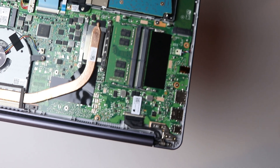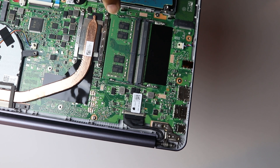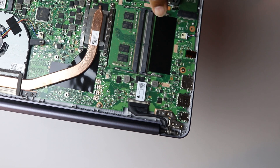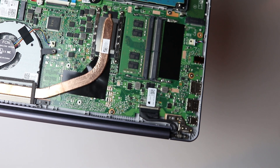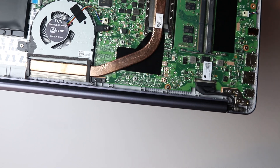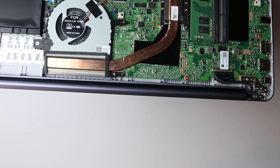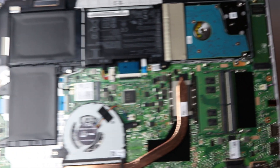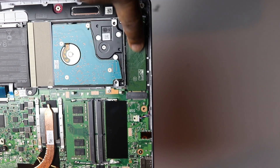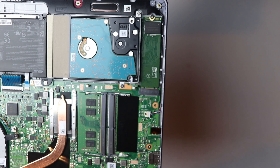The other cool thing is up here — this is my 8 gigabytes of DDR4 2400 RAM. There's another open slot for me to install another 8 or 16 gigs of DDR4 RAM. If you want to make your computer a little more snappy between programs, put some more RAM in. I'll put a link to my computer essentials video where I go over the basics of computer parts. Installing this M.2 SATA drive makes your computer super fast — a night and day difference.